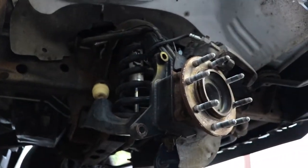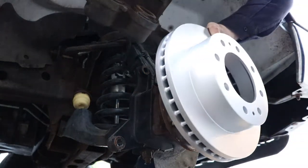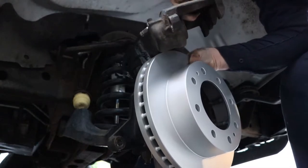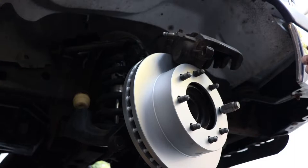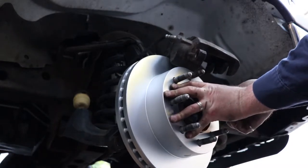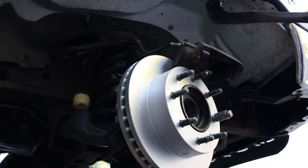Here are some of the critical torque values: 80 foot-pounds plus Loctite for the caliper bolts, and the front wheels are 140 foot-pounds. I've got a half-inch torque wrench. I cleaned up the adapters and got the slides all polished up — you kind of have to work at them with a file and use the hard edge to break off any rust or paint. I've got fully coated rotors so I don't need to wash them off as long as I don't get them dirty. I'll pop the rotor on.